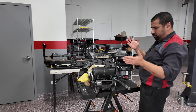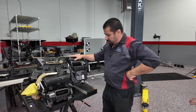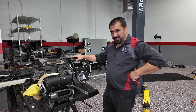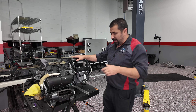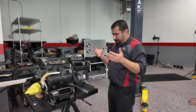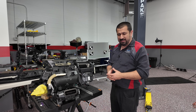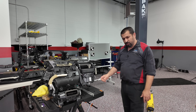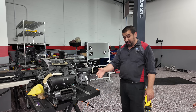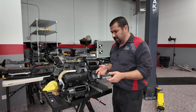I told the owner we could attempt to replace this motor alone, but here is the problem: we have no way of testing it outside the car. I can test the doors inside the unit to see if they're functioning, but I actually have no accurate way of testing it, because all of these wires go to a computer right here that controls it. I know it's not working, but I can't access it to test it.